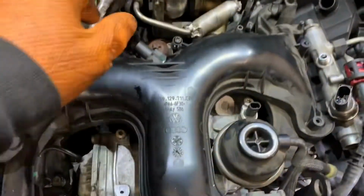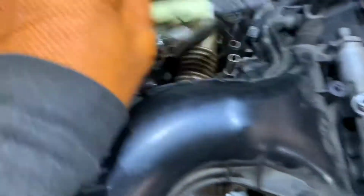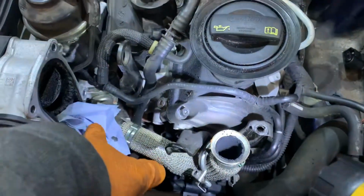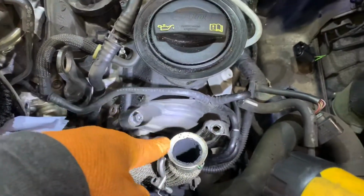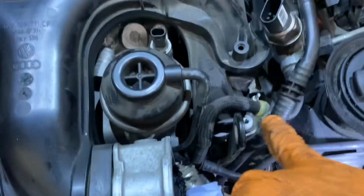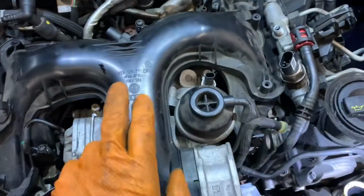Right, so I've moved the high pressure lines from one rail to the other, and the high pressure line from the pump down there, round to the rail. Intake pipe, banjo bolt down here, 4 bolts there, a couple on the bracket. That's now out of the way. Now look at getting the inlet manifold itself off. It's bolted down with several bolts. Hopefully we can lift the whole lot off. Anything that's bolted to it, just unbolt. Hopefully we can get this out of the way and see what we've got underneath.